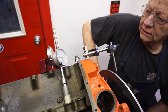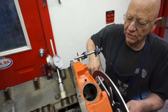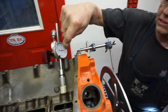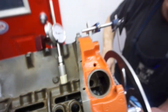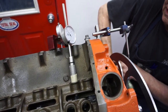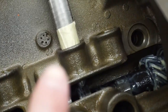And your question the other day — you were saying, what's this 50-thousandths stuff about? You've got this set up at the very farthest, the highest point that cam's lifting. So this is the highest point — zero. And then you go 50-thousandths on either side. So you pull this on around, go back around, catch it on the front side. Here you're going at 50-thousandths, so the cam just rotated that way.